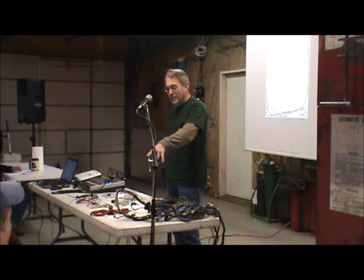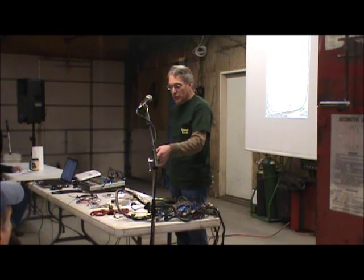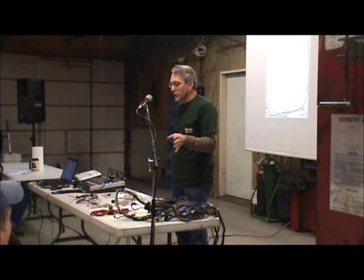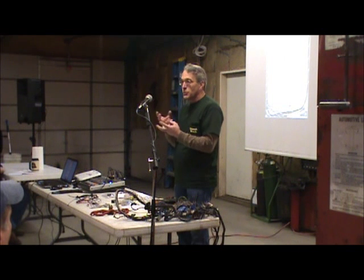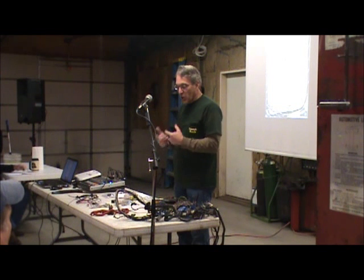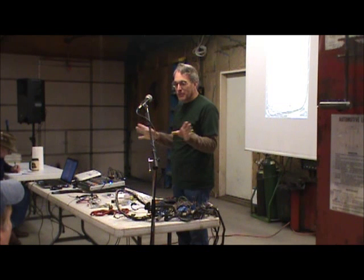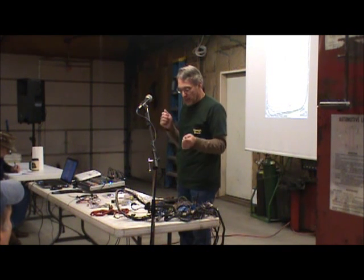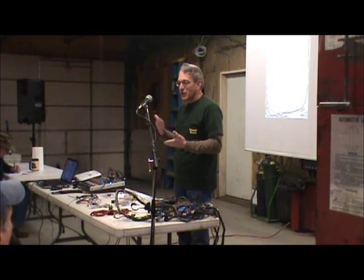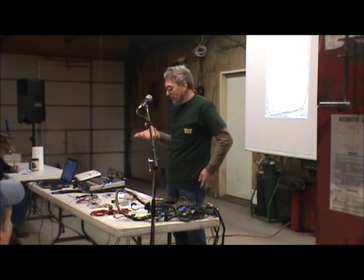There's no need. If you have to cut into the harness, there's a problem with the harness. If something's not working, it's not the harness. Usually, it's what's at either end. Lucas is great for not sealing switches. I mean, you can take switches apart. I've taken switches apart and cleaned them and put them back together, and they work perfectly. But because the switches aren't sealed, the weather gets in there, they get a little bit of corrosion on them, and then they just stop working. You can check things like door switches with an ohmmeter, and yeah, they are actually switching, but the closed state has such resistance that the light won't come on. It's like, okay, well, then that's the explanation for that problem.